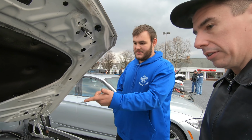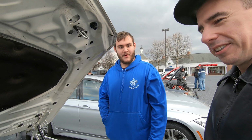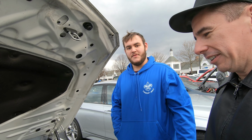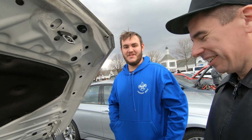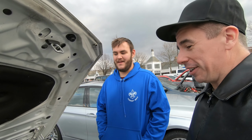Other than that, yesterday I just did a catless downpipe, so it's a little bit raspier, louder. Hoping to do a muffler delete soon, and I'm running BootMod3, whatever you want to call it. And I have the burble tune on there, rainouts off, and that's what I'm using to go stage 1. Stage 2 in the future, I just need an intercooler, so probably spring, be stage 2, making around, I want to say like 500 at the crank. Like 520 torque, something like that.